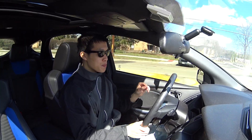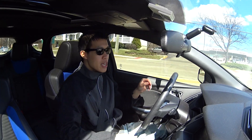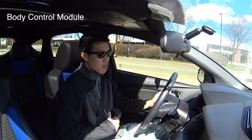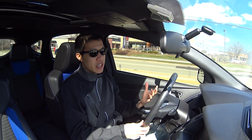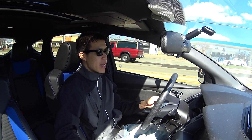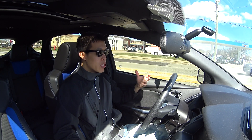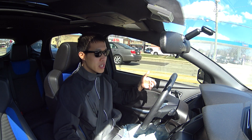Anyways, what car manufacturers have done is they have a specific setting in the actual ECU, or BCM, or however you want to call it. And they have that set to halogen with a specific output. If it's not detecting that output, it'll give you a low beam fault, or it'll say one of your headlights isn't working and shut it off completely.